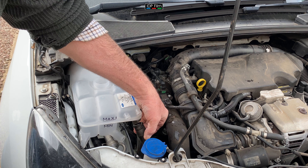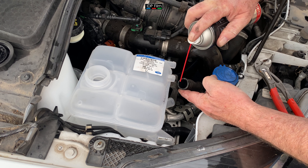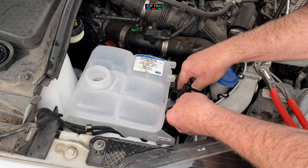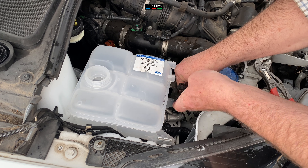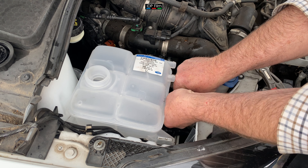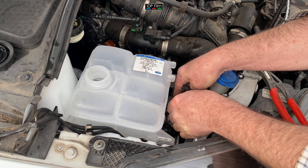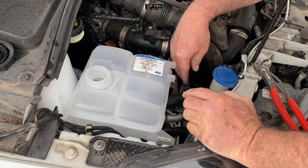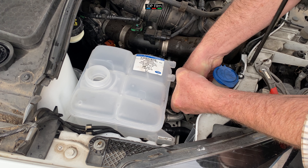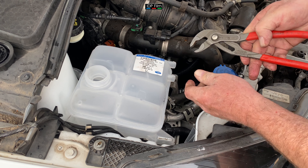They're tight to get on - that's on. The front one's got to be clipped in. Make sure you've got the hoses out. One, two, three - push it home. That's it, that's home. You can hear them clip into place. Now for the big hose at the bottom - because this hose and clip are a tight fit, I'm going to put some silicone onto the plastic to help it slide on. Make sure you get it perfectly round, slide it all the way to the top. There are two grooves in the hose which you've got to marry up with the container neck, and that's got to go on.